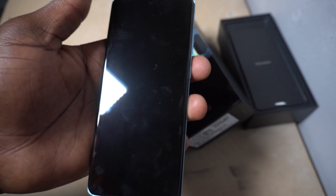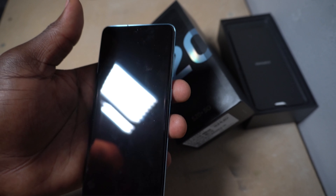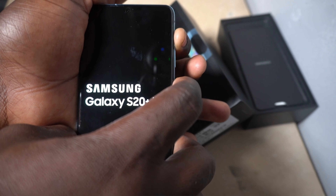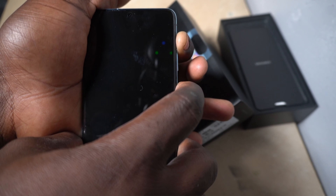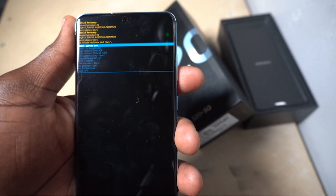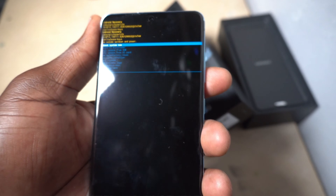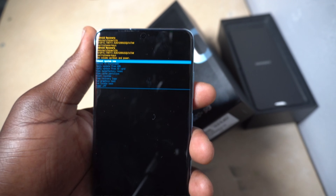Our device is completely off. Now to hard reset your phone, you're going to hold a key combination: volume up with the power button. It goes to the first logo, the splash screen, and then there it goes — this is basically called recovery mode. Recovery mode is where you can clear the cache, flash a software image like a custom image, reset the device, and do all types of things — which is why they don't let you access this menu so easily.